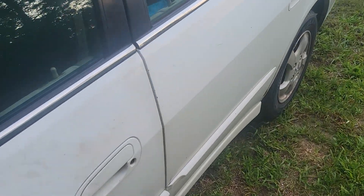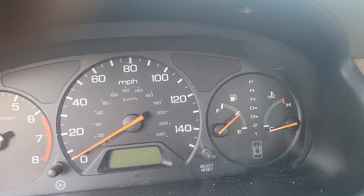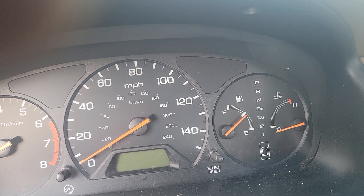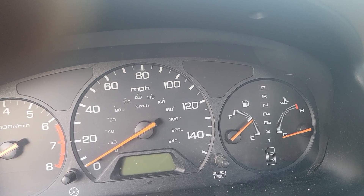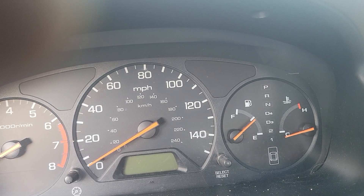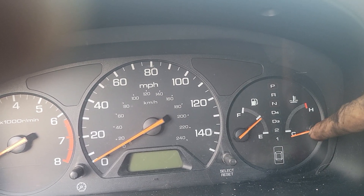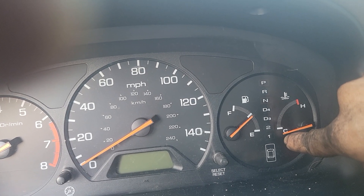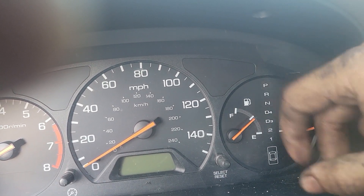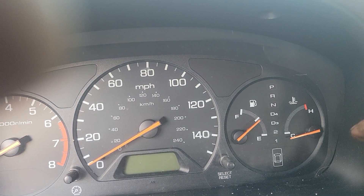Let me take y'all in the car. I'm just going to give y'all a fair warning: if y'all want to buy a 98 to 2002 Honda Accord, every single one I've ever seen - or if yours ain't doing it yet, it's going to do it eventually - your hot and cold hands right here quit working. It'll stay right where this one is and it won't ever move. Sometimes you take your finger and flick it and it might work, but this one quit working.